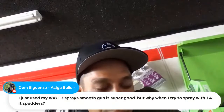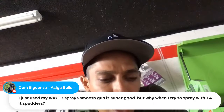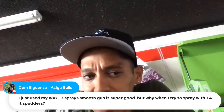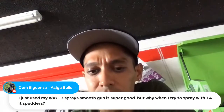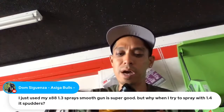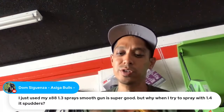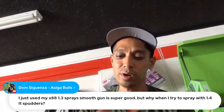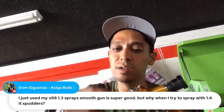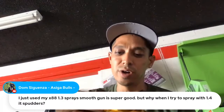Dom says, my X88 1.3 sprays smooth, super good, but when I try to spray with the 1.4, it sputters. I would make sure everything is tight, because you changed your tip, right? I would just double make sure of everything, because if it's spraying smooth and fine with the 1.3, you shouldn't have any issues at all with the 1.4. So maybe just take it apart, clean it, make sure this is tight. Okay, set your trigger and try it again.